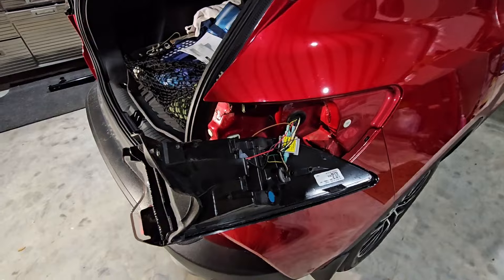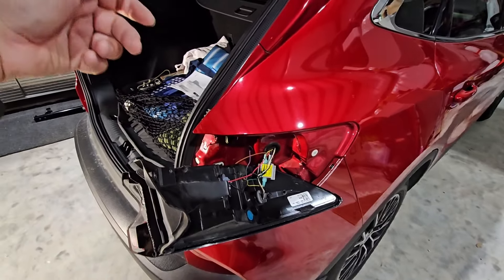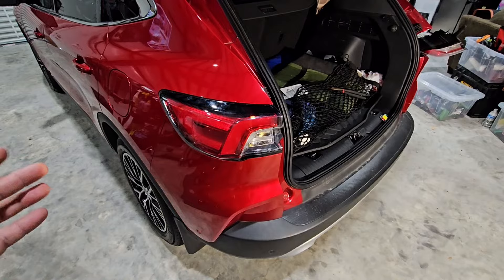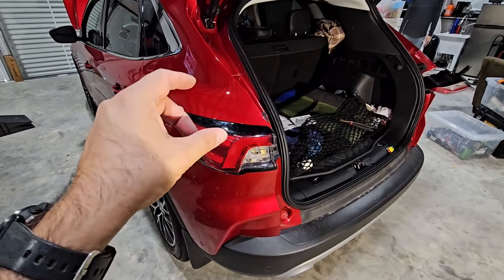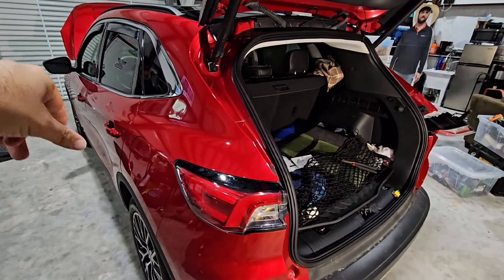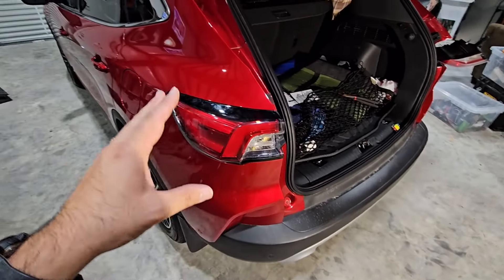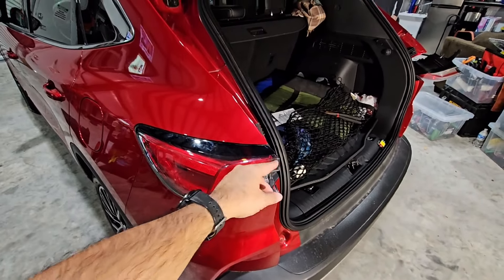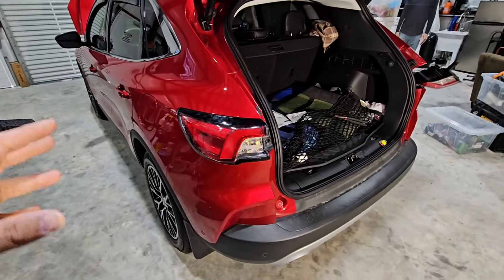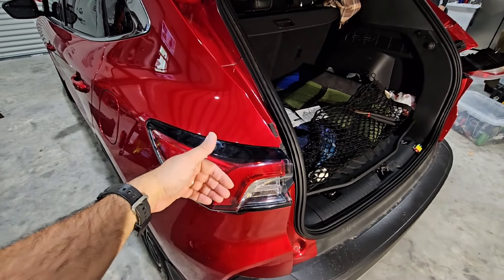We've cut into the brake wires - we already did the parking lights - and we're splicing in the second diode. One other thing my dad reminded me of is how the turn signal will now work on the Escape behind the RV. Traditionally this separate turn signal light would flash, but the way the system works when hooked up to the RV, it actually turns your driving light slash brake light into the turn signal as well. This system basically gives you LED turn signals by using that light as a running light, brake light, and turn signal all in one.